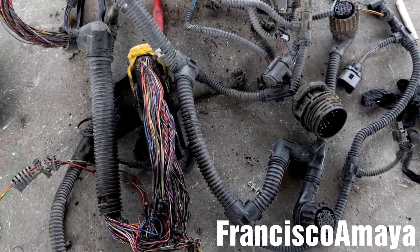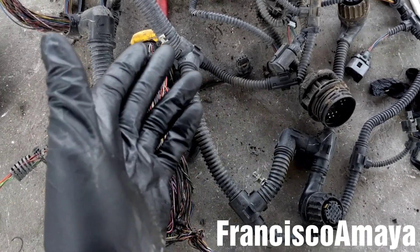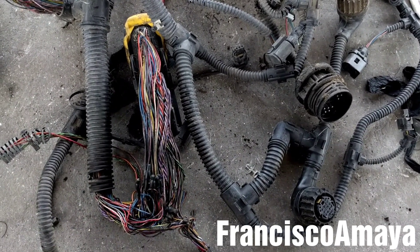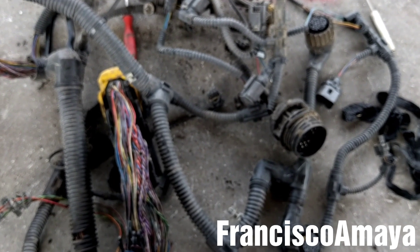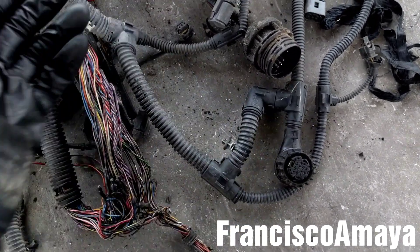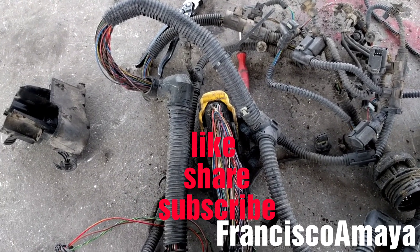I know I'm going to receive different opinions from people saying I'm wrong or right — I'm just sharing my opinion and you're welcome to comment below. But in my opinion, don't replace the injector harness just because it's leaking oil. Even if it's leaking excessive oil, replace it because that's not good, but if it's just a minimal amount of oil getting on the engine harness, that doesn't mean the engine harness is bad — it just means it has oil on it. If you have any questions, comment below and I'll answer as soon as I can. Please like, share, subscribe, and thank you for watching.